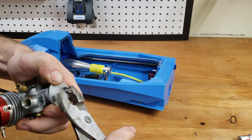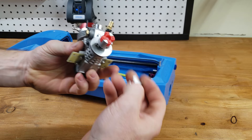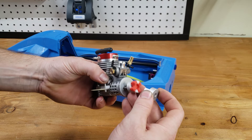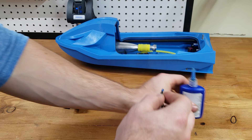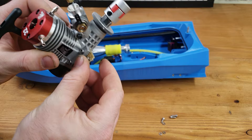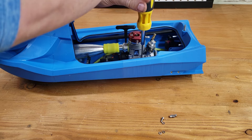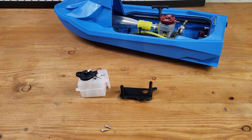We can finally install the engine. Make sure the flywheel is tight. We can then add the coupler while making sure we add some Loctite to it. This red piece on the coupler was really tight so I shaved it up a bit so it would be easier to disconnect in the future. To be honest, I've never tested this kind of coupler so I'm just hoping it doesn't slip on the output shaft — if it is a problem I'll let you know what the fix is in the comment section. Maybe gluing the shaft before you crimp, or adding scuff marks on the shaft. When installing the engine make sure you're using lock washers on the screws because it will get loose over time.